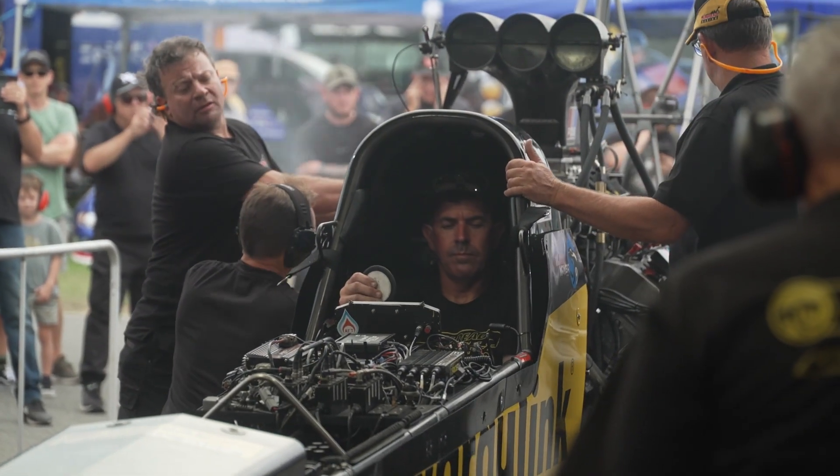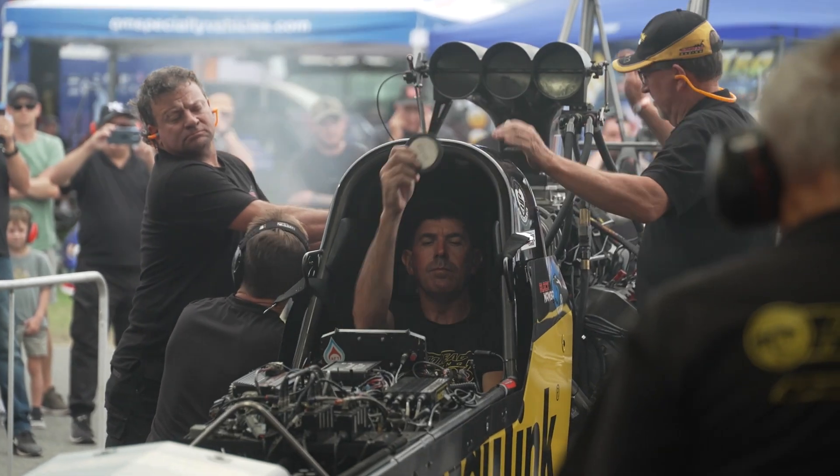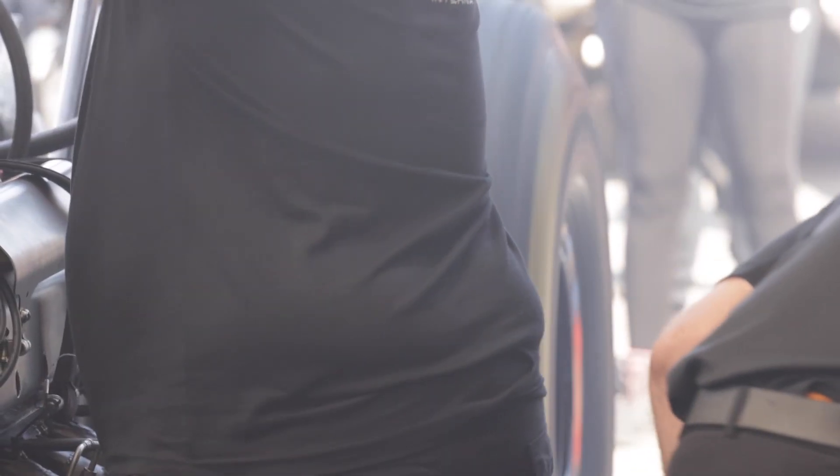We warm the car up, trim the fuel back to a predetermined level. The crew chief sets the idle via the air bleeds to get his RPM right. Then Phil will check forward and reverse, making sure he's got a good feel on his clutch pedal. Then Daniel will check the timing on the mat — on the timing lights — to second-guess the computer.